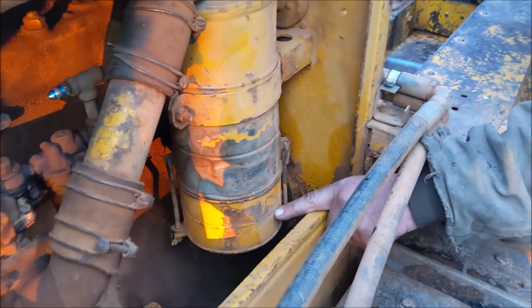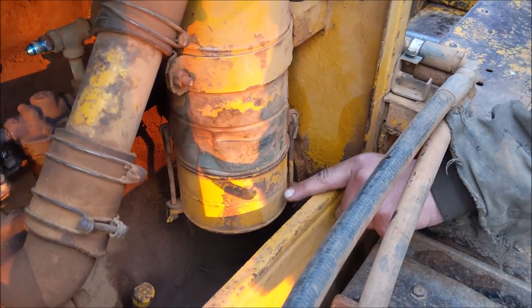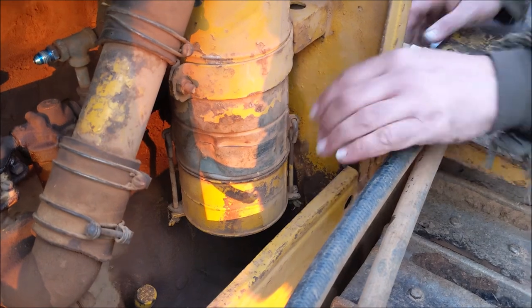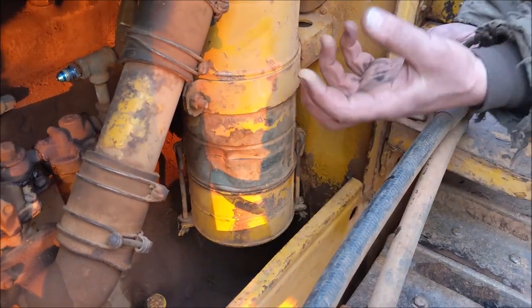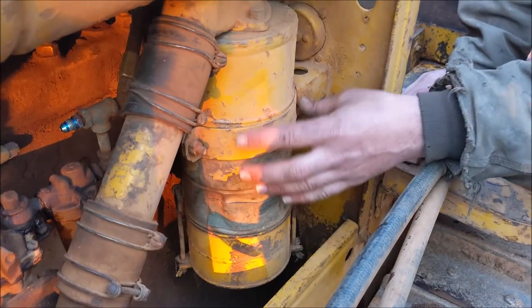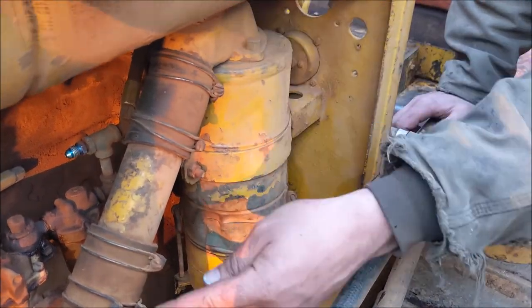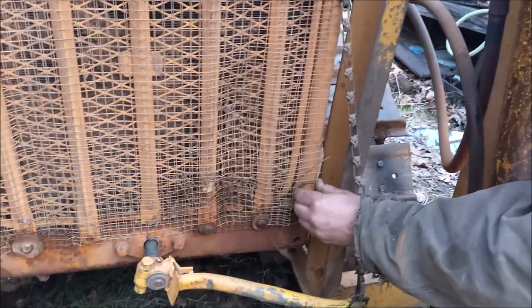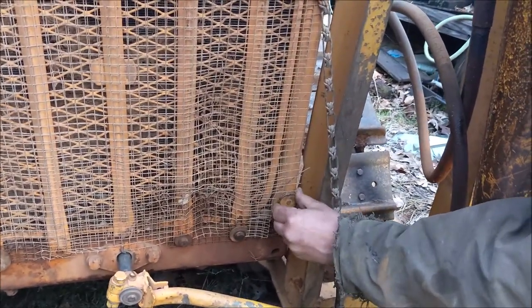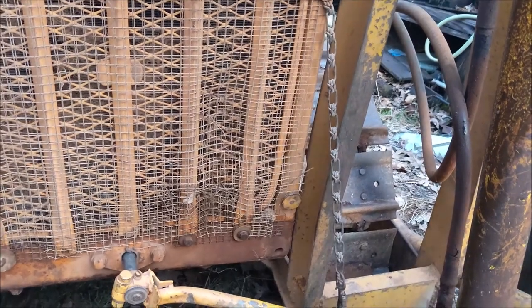This line right there is for the oil level. Oh, okay, that makes sense. So the oil will be here. So the air has to come in and go down through the outside, through the oil, and then up through like a wire mesh that's inside this whole zone, right. And then down into there. That's why it's right out front when you're cranking it. Yeah, so you can choke it or not. Choke off when it fires.